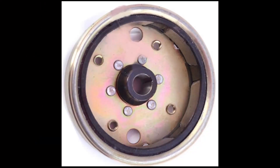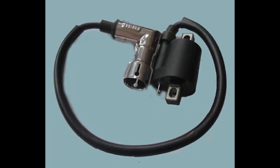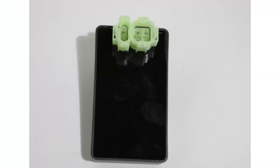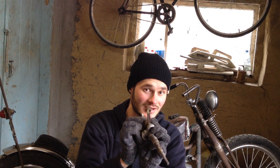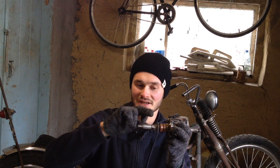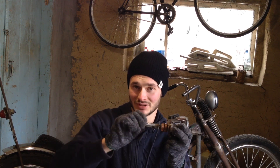In the morning I rode to the store and bought a CDI generator, CDI magnet, two scooter coils, and an AC module. The AC module is the one that needs a high voltage coil in a generator, because a DC module that doesn't require a high voltage coil doesn't like to work without a battery. Then a friend gave me a scooter crankshaft, I cut off the magnet taper, went to a turner, and he made me a 6mm thread in order to screw in this magnet taper instead of the fan bolt in a Dnipper armature. Everything should've been bolted like this, and a magnet of the CDI generator should've sat on this taper.